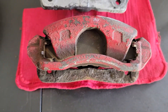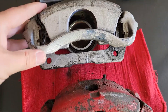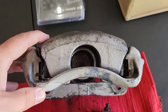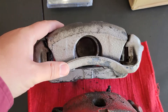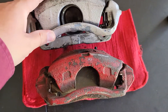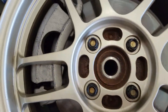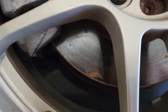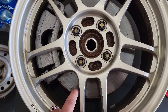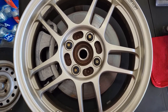These are the 98 EX spindles I got from my friend — they came with these. I'm not sure the diameter of the piston. But I grabbed some ITR calipers from Tommy's — I don't know if I ever pronounced that right, but I got these from Tommy's brother. They took care of me. They're significantly bigger, trust me. No hitting on the inner drum or anything. You can see how much more bite there is with the ITR caliper. I'm going to use the base model Mini Cooper rotor with TSX pads, and it should do pretty good with this lightweight car.